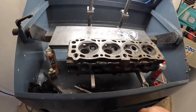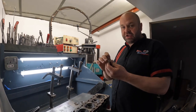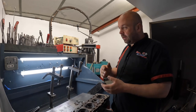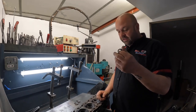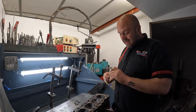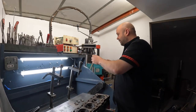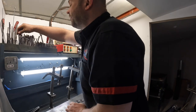So the first thing I'm going to do is get some measurements of the valve seat I'm using — measure the OD first and then minus out what clearance I want. However, what I'm not going to do is bore straight to that size, for the simple fact that the tooling can move and the fit of this is very, very important. We're going to freeze the seat and warm the head up as I'm fitting it. What we don't want is if the tool moves and makes the bore oval, or takes even a thou more out than it should — the seat could fall out and we'd be in a whole world of trouble. Best to do it in two cuts, get it within about a tenth of where I want to be, and then finish off the last cut before I install the seat.